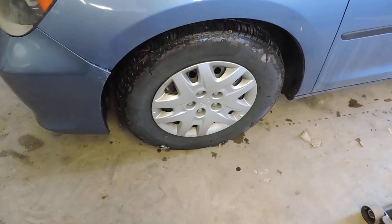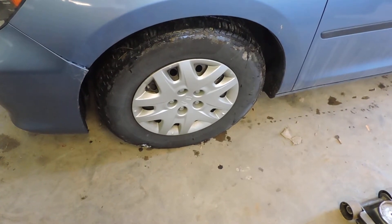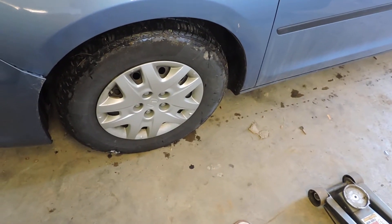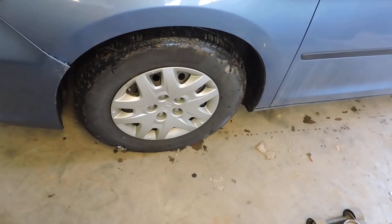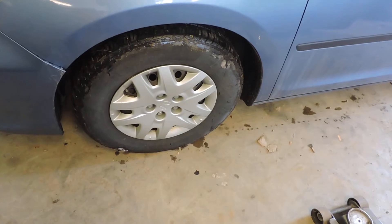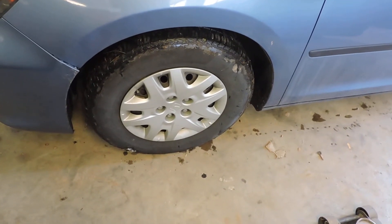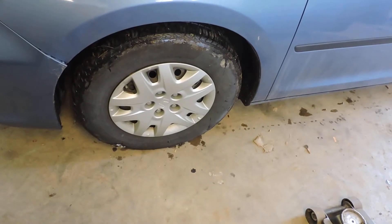While I have the wheels off I'll also examine my brakes and rotors — are the rotor surfaces smooth or scored, and do the brake pads have plenty of life left? I'm getting a bit of a squeak from my left rear right now and I've got to figure out why. Maybe one of the calipers is sticking. I'll check the brakes while I have the wheels off, and then I'll be good for another six months of tire wear. This is a homeowner thing — the shop doesn't charge a lot for a rotation, but the advantage is I can examine the brakes and rotors myself.